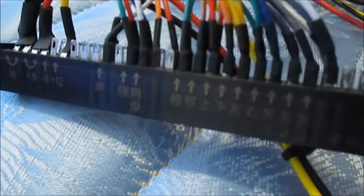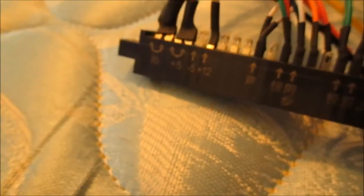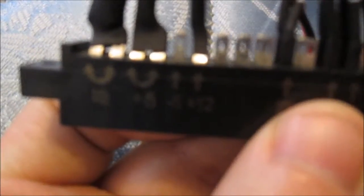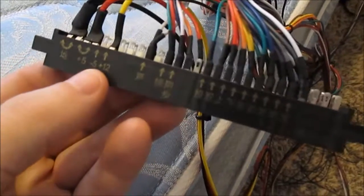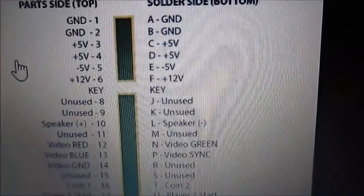See how these — one, two, A and B — is ground. Then you got your positive — pin three onward. One, two is ground and they got their grounds, easy to spot. Then you got this one labeled for you: plus five, minus five, plus twelve — same on the other side, positive five volts.